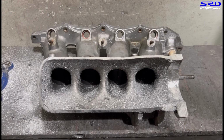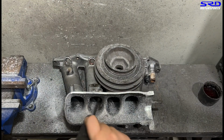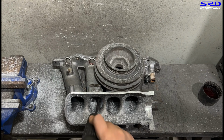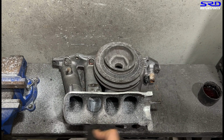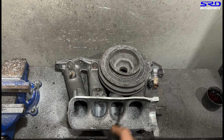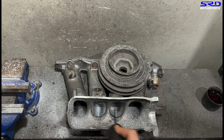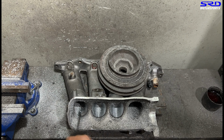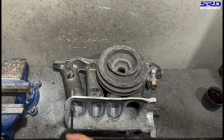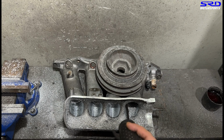We're going to start with a carbide first to get the shaping going. You can see we start from the side, because there's a lot of core shift initially here. So we use a carbide. It's going to take too long if we go straight to the 80 grit. So we go into carbide first, initially the first 2 inches of the runner. This way we're going to infuse a bit more taper. It's going to be improving good.